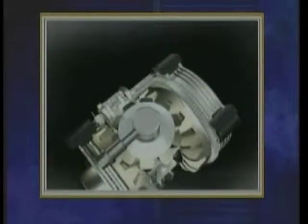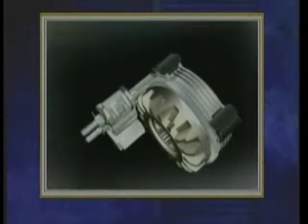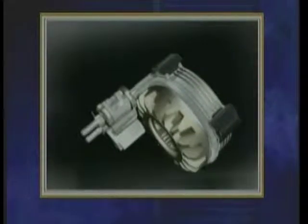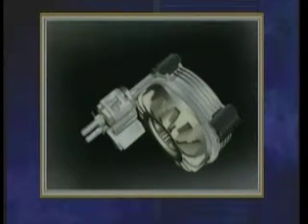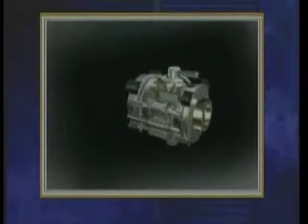With one wheel spinning, the cam side gear rotates relative to the case. This causes the engagement mechanism to rotate at a higher speed. At a given speed, the flyweights will swing out and engage the pawl on the locking mechanism. This produces force on the cam plate, which rotates into the ramping position. The friction disc pack compresses, causing the cam to energize until sufficient torque locks the wheels together.